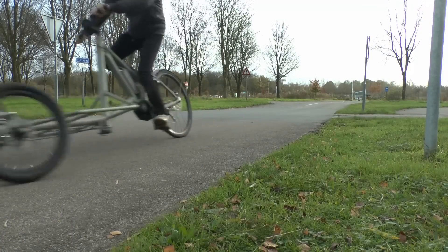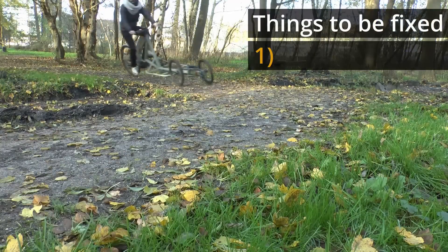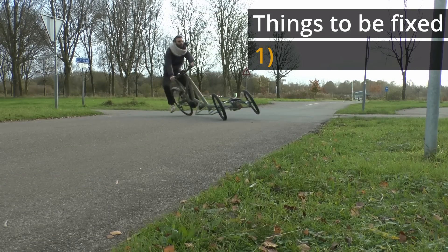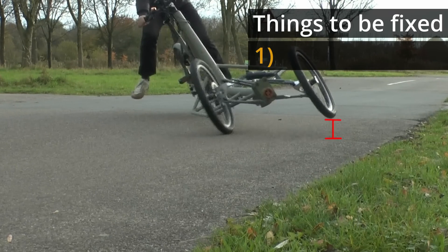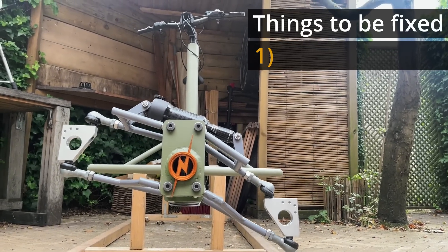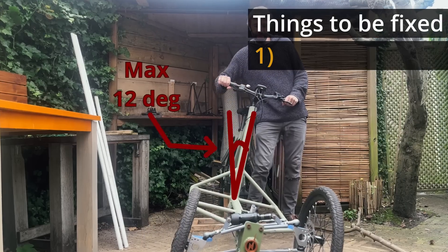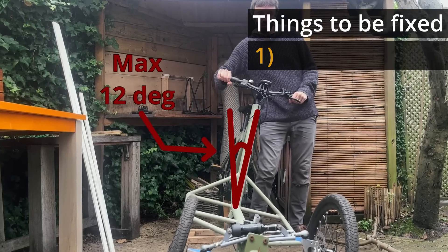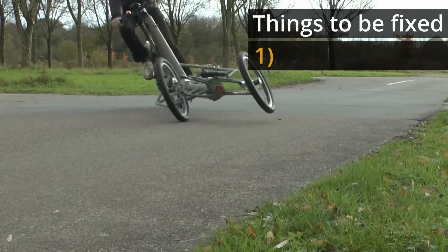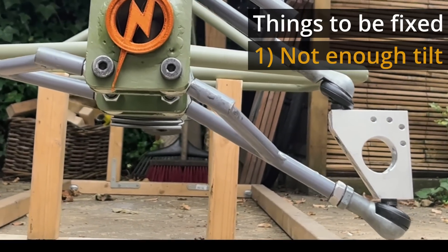It's time to talk about those three things that need fixing to make this a product-worthy design. In this test I was trying to find how fast I can make a 90-degree corner. So what you see there is the outer wheel raising. This happens because the tilting mechanism has reached its end. The component that reaches the limit is the lower outer ball joints, which are capable of moving 30 degrees. This results in a maximum tilting of the vehicle of 12 degrees. So when you're doing a fast, tight turn, this happens. It may look cool, but it's not — the behavior of the vehicle changes mid-turn and it's unexpected. My conclusion is that this type of ball joint cannot be used here.